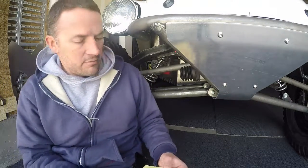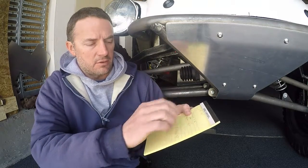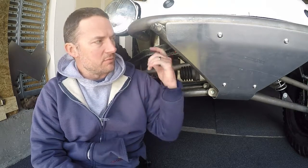I designed the whole front suspension, and unfortunately when I designed it I set the droop so that just at the droop everything was just not binding — so that's how I set the droop, and I'm very happy with that. However, I set the upper limit, the compression, right where the tires were even with the fenders. In hindsight, because of what I'm going to end up doing anyway, which is cutting some of the fenders back so the tires will actually go past the fenders — that's how I should have done it the first time. Because in order to change my travel, I need to change the angle of my shock absorbers and where they connect at the control arms, which means I would have to modify or remake my lower control arms, and I would have to remake the upper control arm because if the shock is leaning farther back I'm going to have to clearance more out of there. So that's a lot of work.